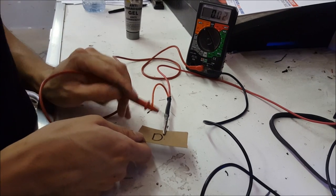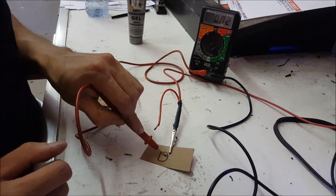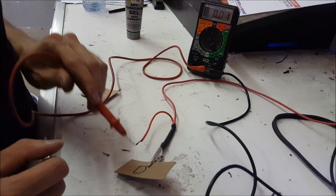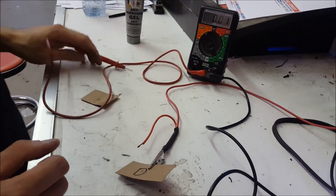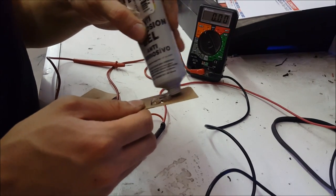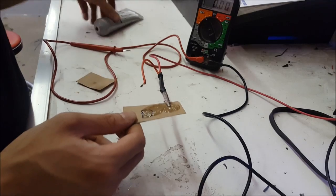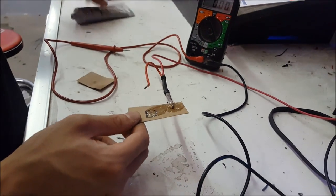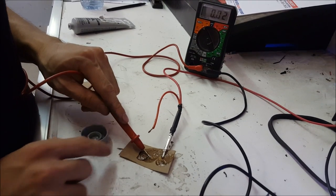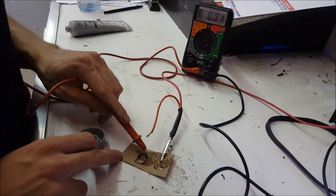Test again on metal: 12.77, 12.78. On the cardboard alone we register 0.01 on the multimeter — we'll call that our zero reading. Now with dielectric grease applied to the cardboard, giving it every possible chance to conduct — touching the cardboard in the dielectric grease — we're not changing readings. Just a little movement from touching the cardboard itself, but nothing that would actually suggest conducting.